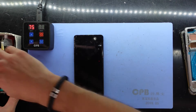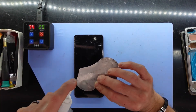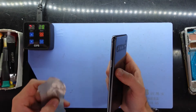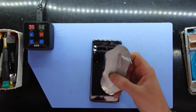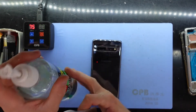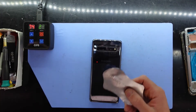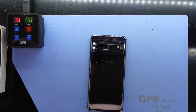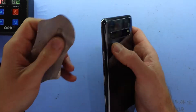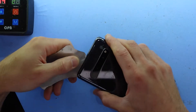It's one that I haven't really worked on before so it's new to me, but I have had this one opened up — that's when I discovered I had the wrong part. To begin with we want to use a thin metal pry tool, some isopropyl, and I've got it on my blue heat mat here which has been heating it up to 75 degrees Celsius for about the last five minutes. Granted I've had this off once before so it's going to come off pretty straightforward for me.